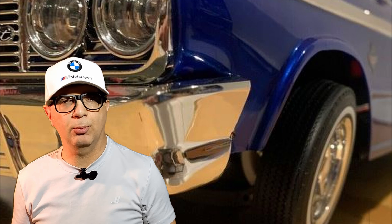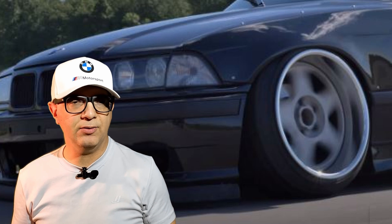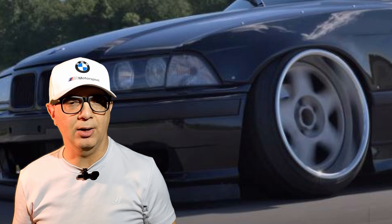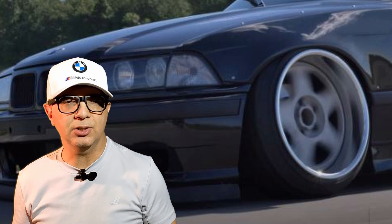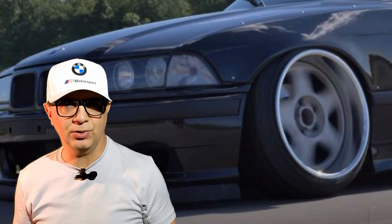Positive camber is not a desirable camber setting for any vehicle. Finally, negative camber is where the wheels are angled out at the ground. If done correctly, this greatly increases handling and lateral acceleration. Let's get over to the vehicle and demonstrate camber.